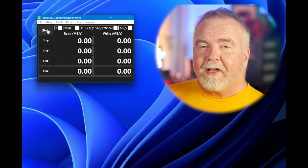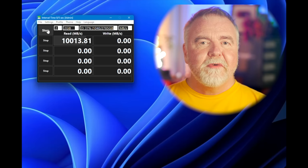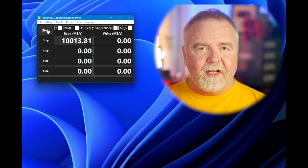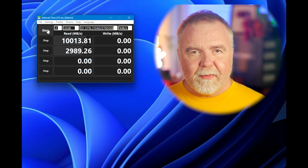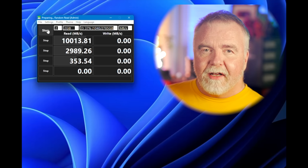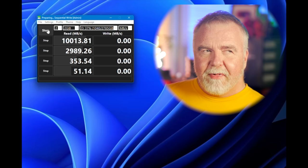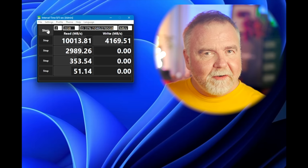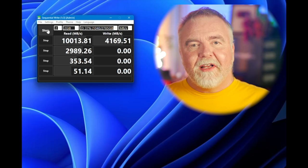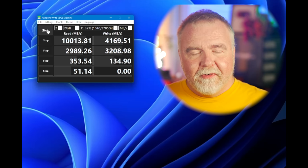In my own system at home, I have three SSDs striped in this manner and I get some impressive speeds as a result. This is a stripe set, which means it reads and writes data to and from each of the three SSDs at the same time. Each drive is capable of about 3,500 megabytes a second on its own, so in theory I should get nearly three times that. The drives are connected via PCIe 4x16 interface, and using Crystal Disk Mark I'm able to benchmark the drives at more than 10 gigabytes a second — not gigabits. All courtesy of RAID.